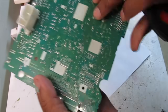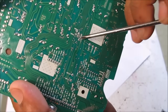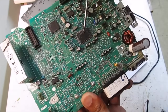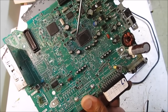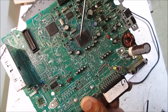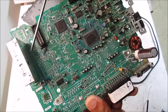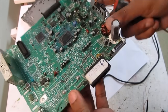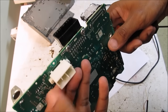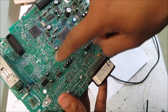This here is where the CD connects to the board. You might be tempted to solder your aux wires to the left, right, and ground of the CD, however I've traced these and they actually end up going nowhere — that's because the CD uses a digital output and uses the data port. This here is your digital sound processing unit; it communicates via the I2C bus and that tells it which input to select, whether a digital input like your CD player or an analog input like your FM modulator. The second method is to inject your auxiliary lines to the left and right input of your CD changer or Honda accessory, which uses this 14-pin connector. For that you're going to need a CD changer or some other device that uses the MBUS protocol to talk to this chip to tell it to select this input.